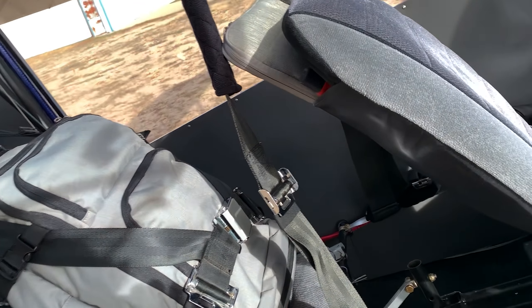I've got to face these off a little bit because they're a little too wide and the bolt holes don't line up. I'm going to put a flat spot on them — that should provide more coverage area, which makes everything a little bit tougher. The spacers are in. You can see them underneath there — they stick out a little bit, but I don't think there are any clearance issues. Bolts are just snug right now. I'm going to Loctite them with something removable. The bolts are longer, they're a size up, the spacers are bigger — that'll be way tougher than it was.